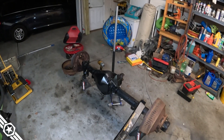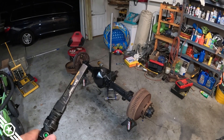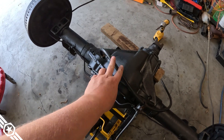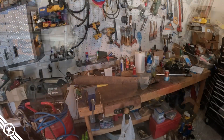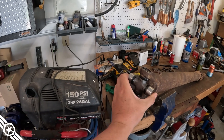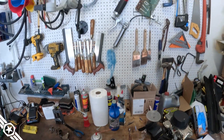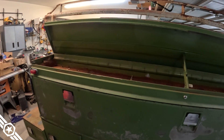Safety check: fresh wheel cylinders, brake shoes, new hardware, rear wheel bearing seal — other side is already done. Going to throw that side together, get the brake line back on, paint everything up, and throw it back under the truck. The axle is back in — painted three different shades of black with a brand new center brake line and vent hose. I also replaced the rear U-joint: it was slightly loose and very dry, but I was able to rebuild that one with a grease gun, so it'll probably be fine.